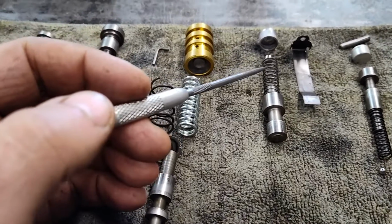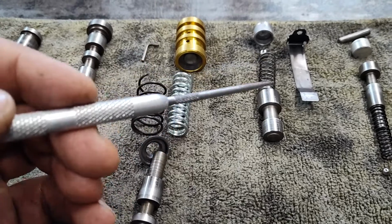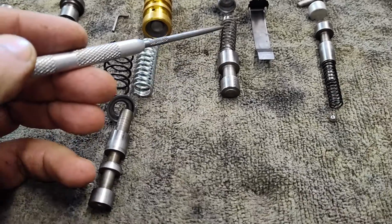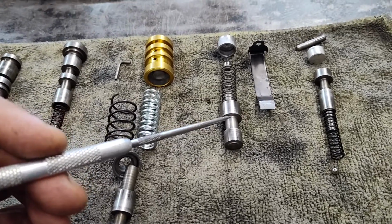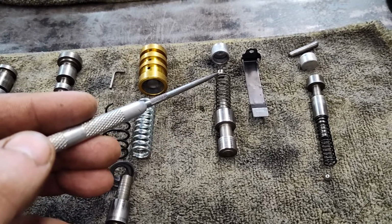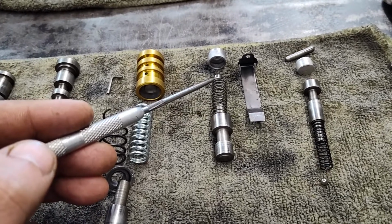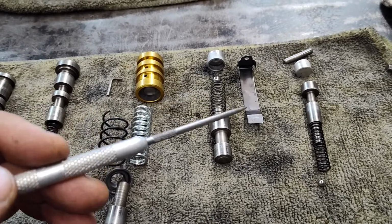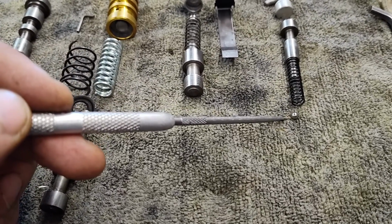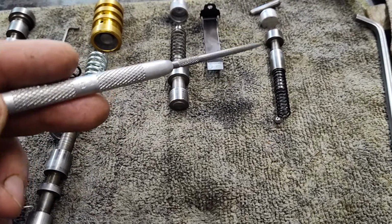So this one here, there's a 1/4 inch ball in the kit, and that's going to go here. This just stops this valve from stroking. That's all that ball does. If you have trouble getting this one in the bore, like I just showed you on the other one, it doesn't matter, because we're making it not stroke anyways with that 1/4 inch steel ball. Make sure you put the steel ball there, not the plastic one. The plastic one goes in the channel plate like I showed you before. So this one here, this is the smallest steel check ball. That's just going to stop this valve from stroking.